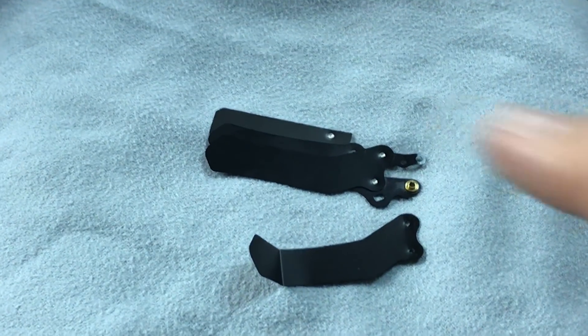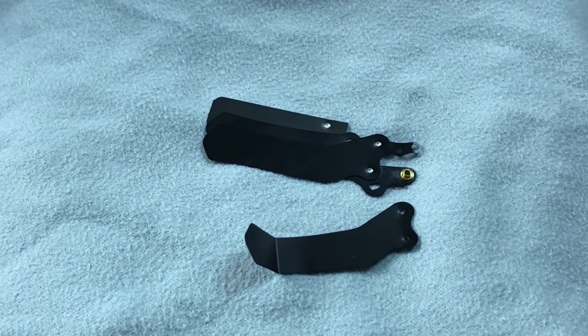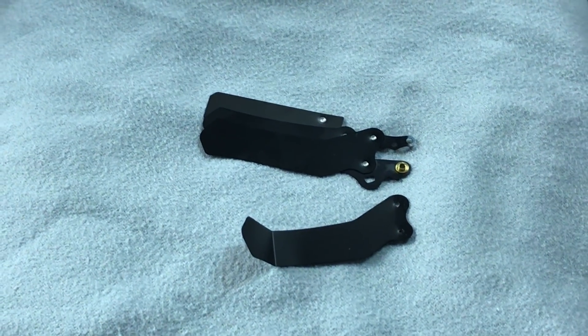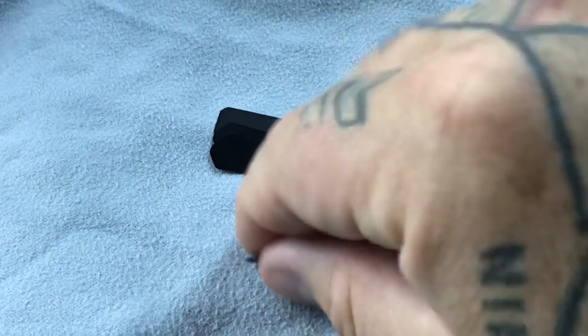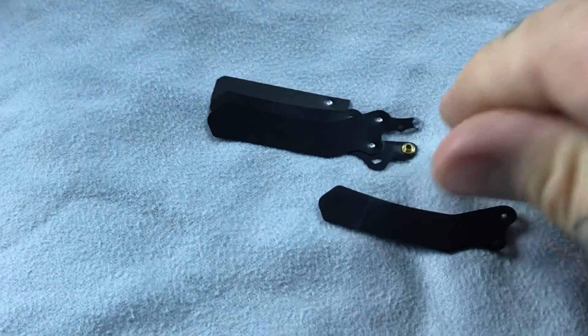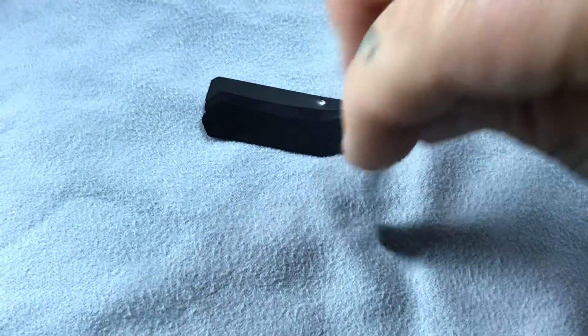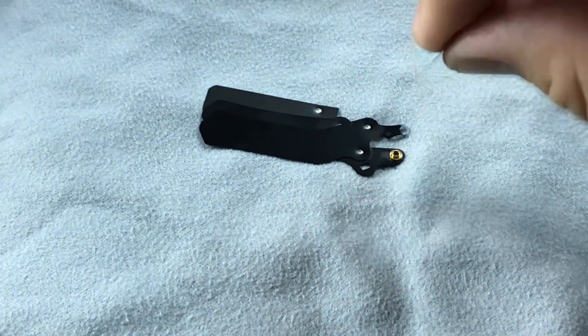But if you get a tiny piece of grit or dust on one of the shutter blades, and the other curtain tries to go over it while you're shooting at 10 frames per second, that causes the blades to warp at high speed. And once they start to warp, they get worse and worse. This is the shutter blade in any modern camera — yes, it is that flimsy.